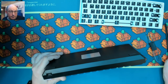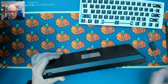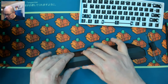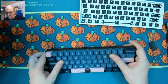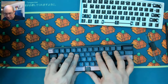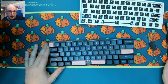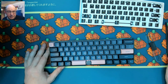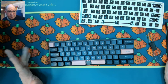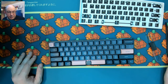The keycaps are PBT double shot, which we can see, but this says that it has, I guess there is a little bit of flex in there. It's using an O-ring gasket or burger mount, so it's not crazy, but there is a bit of give when I push. And it shows that it has the plate PCB gasket. It also shows that it uses the silicone O-ring between the positioning plate and the screw to serve as a buffer. And they also have it extend out and create kind of like a switch pad.